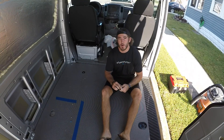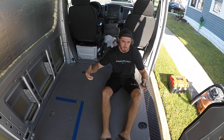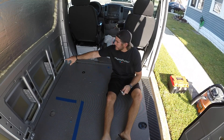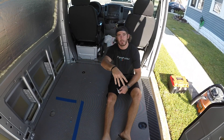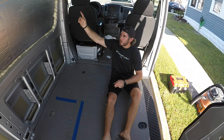We're going to do the ceiling insulation last because we want to install roof rails and we're going to be installing solar panels, so we'll be cutting through the roof. If we did all the insulation first, we'd be cutting all through that and probably making a mess, so it's just easier to do that later. We used one whole bag of wool insulation and we don't have enough to fill all the gaps of the lower section on the driver's side. We finished the rest minus the ceiling, and we just finished putting all of the Great Stuff around the foam board.